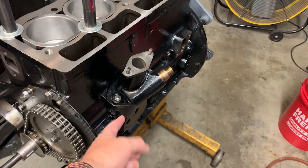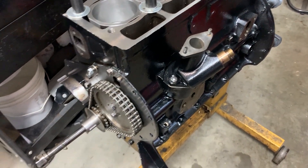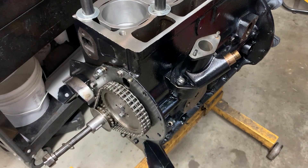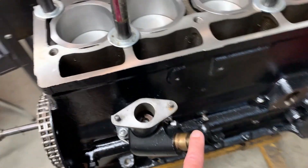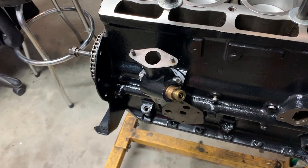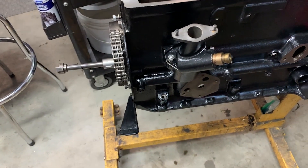There's a shim in here that you need to get right. I managed to do that — you put a washer in and measure the cap and so on. So that looks all good. The tach drive is there, and I am pretty happy with where this is at.